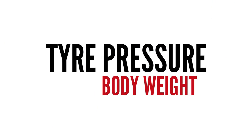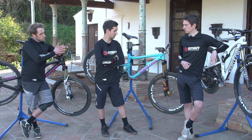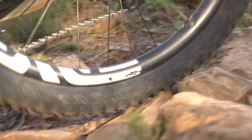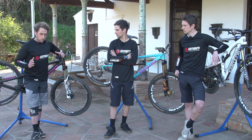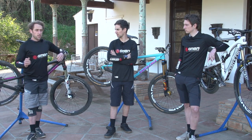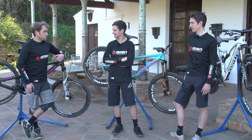What about weight — as in body weight? Yeah, I think definitely for heavier riders, you're going to have to put a bit more pressure in. The rear is the one that takes the hits — that's the one that's going to pinch quickest. What about bigger riders on downhill? I think if you take me as a rule of thumb, I've got 0.1 bar difference between front and rear. So if that was a rough gauge for anyone who's say 75 kilos, at 85 kilos you're probably going to have to go up a couple of PSI, half a bar.